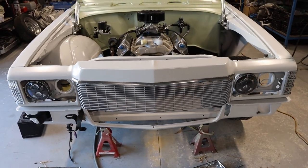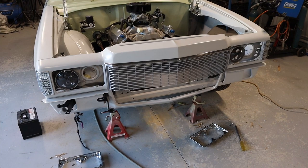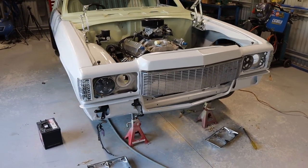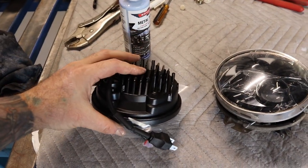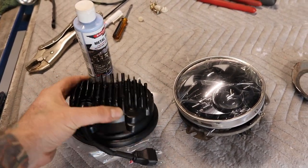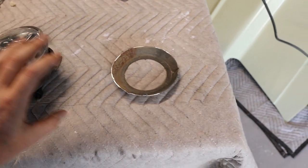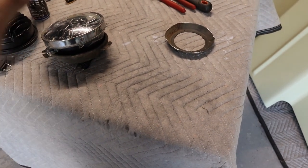I've mounted a couple of the headlights already and it does require a little bit of modification. I did those two off screen since I wasn't sure exactly how I'd do it, and I'll show you on this third one. Because of the ribs on the back for the heat sink to cool down the LED assembly, it's quite bulky on the back end and doesn't sit in the buckets well. It needs to come down roughly 20mm, so I've cut that much out of the back of the bucket.